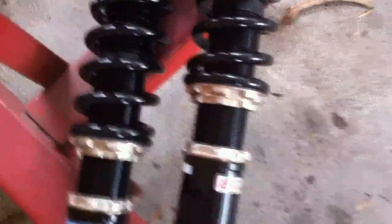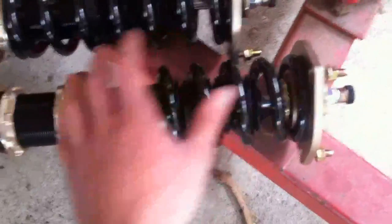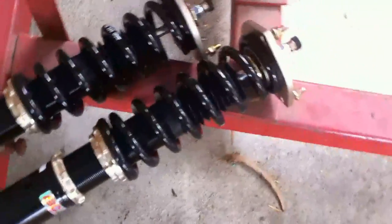When you want a low ride, you don't want it to be really, really hard. Whereas with these ones you can adjust that separately. You can adjust the spring preload, so you can adjust it really springy, or really hard, or whatever you want.